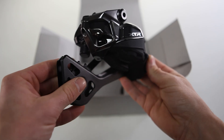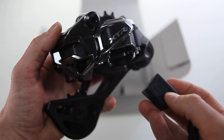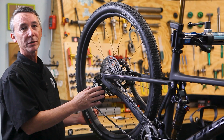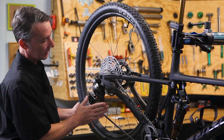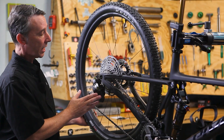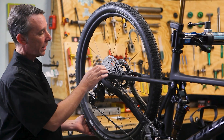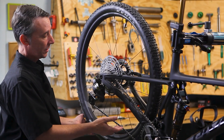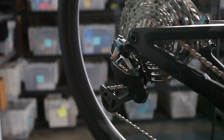This is the most exciting part for me — Shimano has gone fully electric and fully wireless with a removable battery. Shimano decided not to go UDH; they're sticking with a traditional hanger because they feel it's more important to be able to replace a hanger without potentially damaging your frame. The front of the derailleur has been streamlined to help with rock strikes. They accomplished this by removing the clutch and replacing it with a dual spring inside. The dual spring, combined with extra chain wrap capacity, gives 70% more chain tension than the previous derailleur — even without a clutch.